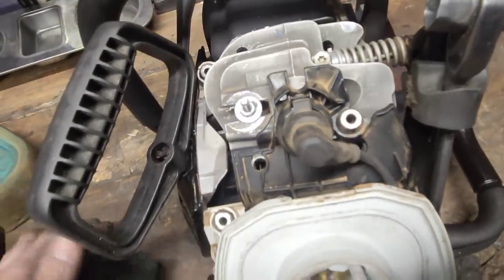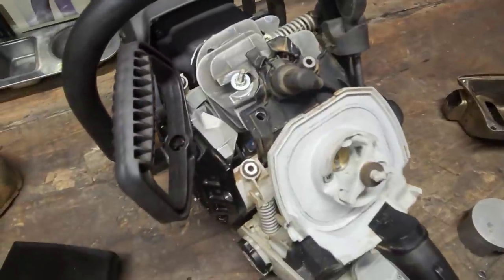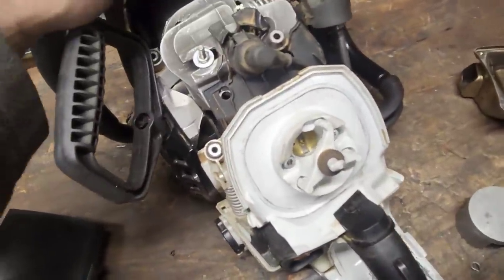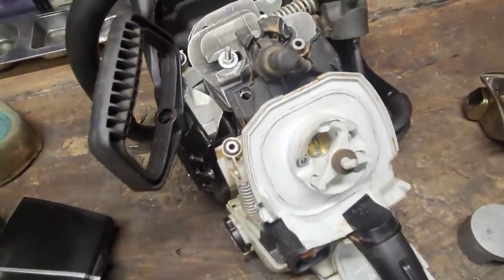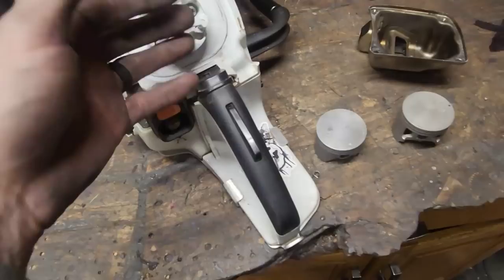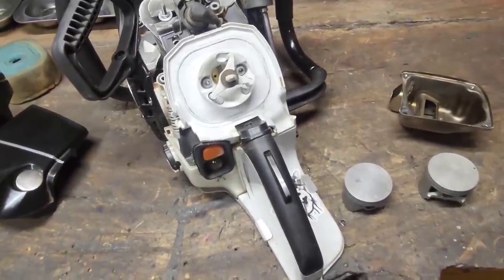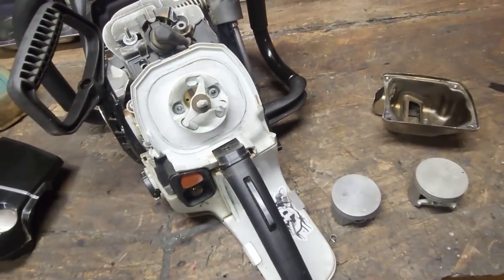The decompression plug — that's not a huge deal. I don't do anything with the injectors or anything like that. I have played around with that stuff — they get more fuel than they can handle. The problem is mapping. I've tried piggyback CDIs and ECUs, and these ECUs are really smart. For example, if you unplug the stop switch it won't start — which on a normal coil, if you unplug the ground lead it'll run, you just can't shut it off. This is the opposite: if you jump that stop switch it still won't run. Kind of wild.